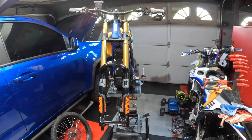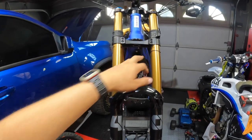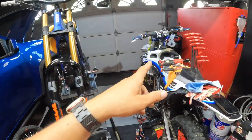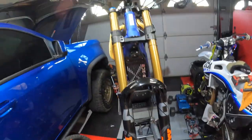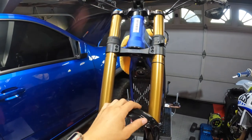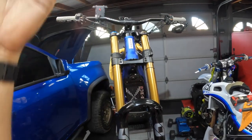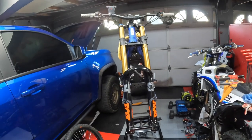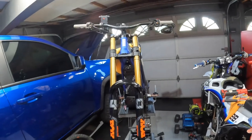So far I haven't had any issues — the biggest thing is probably that bearing, just trying to get the old one off and put it back on. I've tried to do that before on my FC 450 and that was a pain even with the tools. So 60 bucks — or around 40 on Luna Cycle — and you've got yourself a new one. You can pound it down if you want, or take it to your dealership like I did. The install will be as easy as you've seen this go so far.